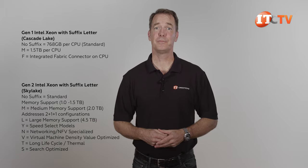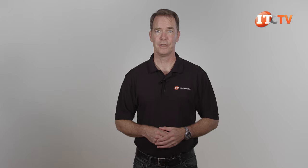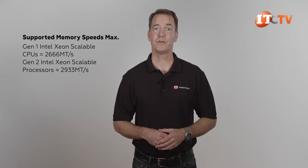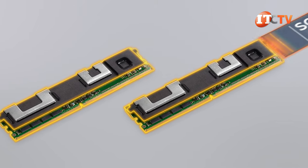You will need an M-suffix processor if you plan on installing the maximum memory of up to 6 terabytes. Each processor has a complement of six memory module slots to either side for 12 total per processor and 48 active memory module slots with all four processors. Memory support includes registered, load-reduced, and up to 24 NVDIMMs. Gen 1 processors support memory speeds up to 2666 MT/s; with Gen 2 processors that bumps up to 2933 MT/s. This system will also support just over 12 terabytes using Intel Optane memory modules, but only with Gen 2 Scalable processors — sadly those were sold during the filming of this video.